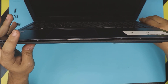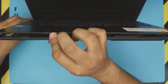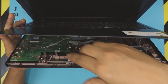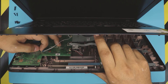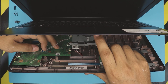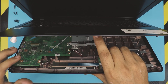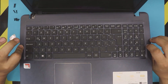Do the sides as well. Once you've got the sides open it's just going to open up — don't yank it up because we still have to remove the flex cable for the touchpad. To remove it, unhook the plastic right here, lift up the white plastic to about 90 degrees, and the flex will slide out. Same thing for the keyboard connector: lift up the black cover and the keyboard connector will pop out.